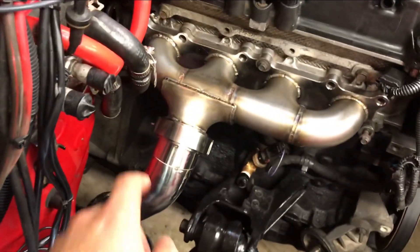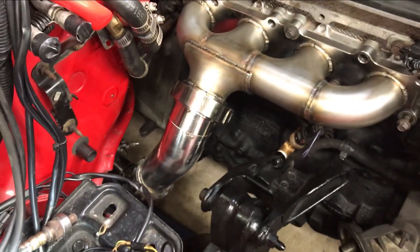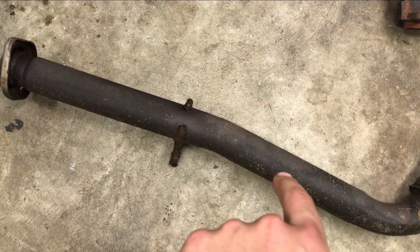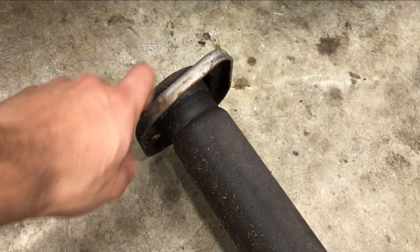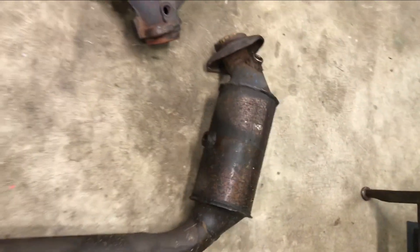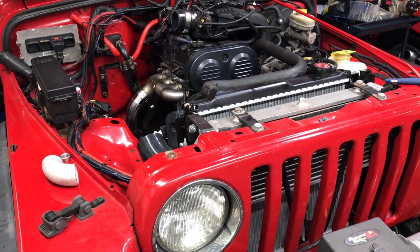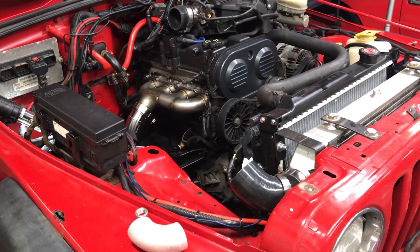Also not in this downpipe right now are the O2 bungs for the primary and secondary O2 sensor — those will be in there. I may also put another O2 bung in there for a wideband if you guys want to do any NA tuning. Going back to the factory downpipe — the tubing I'll be using is a little bigger, about 2.25 inch, whereas the factory setup necks down to something really tiny, I think 2 inch or even less. Any increase in flow is going to help our little 2.4 liter get a little more power. I actually want to hopefully give one of you guys a system and have you dyno it to see if it makes a difference.